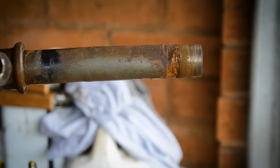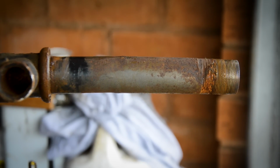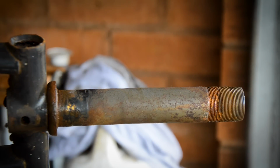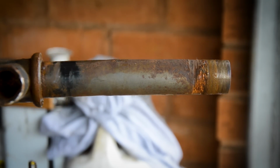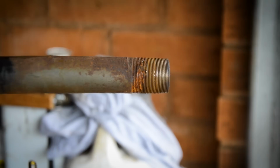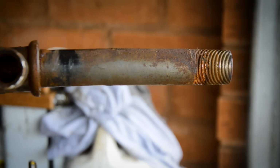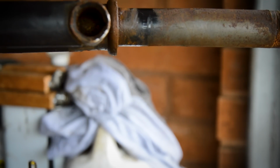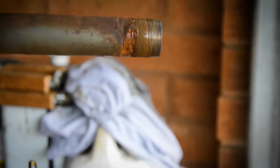Okay, this is the fork. It is not in a good shape. I don't know if you can tell just by eyeing it. That does not look straight to me. This steer tube, I believe, is bent. If I put it in my vise, the top here, where the threads are, and the bottom here near the crown, have some air in, whereas the centre here is touching it, and vice versa. On the other side, that is touching, that is not touching, and the bottom half there is touching. So I think these forks are bent, or the fork is bent.